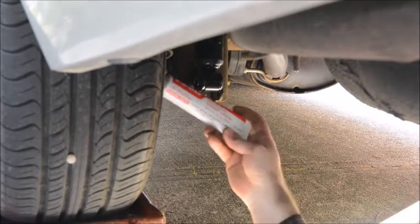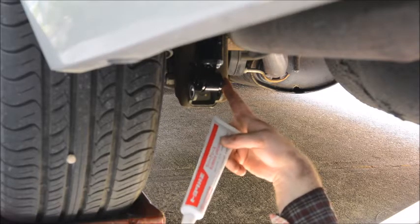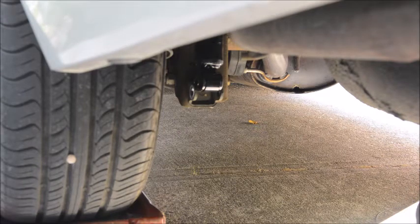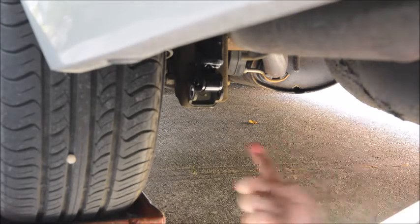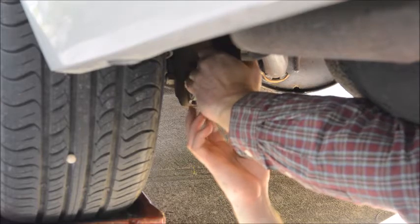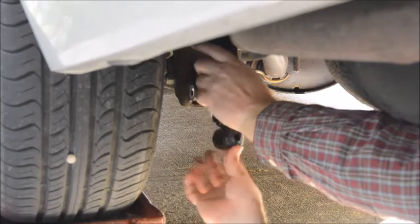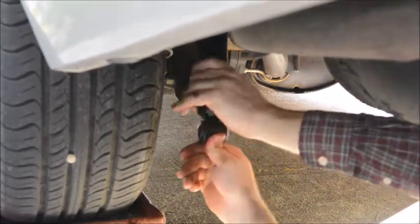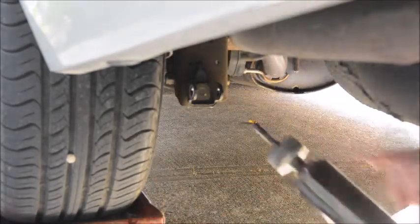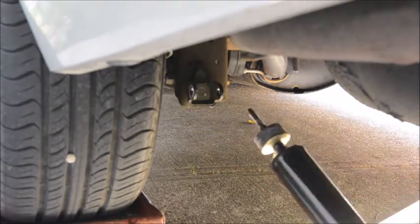One thing I forgot to mention: I like to put some rubber grease on the rubber grommets that come in the clevis from the new shock. This helps it slide into the clevis better and will also help mitigate any squeaking. I'm going to put a little dollop of grease on the rubber grommets here, and also some on the top bushing. I've put a little bit of this Toyota rubber lube on the top rubber bushing and we're going to put that through the body.